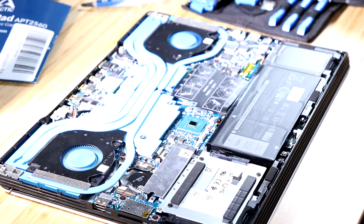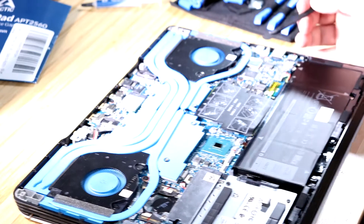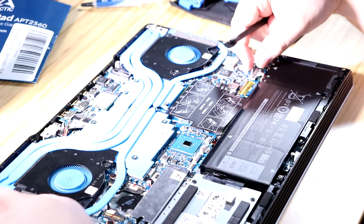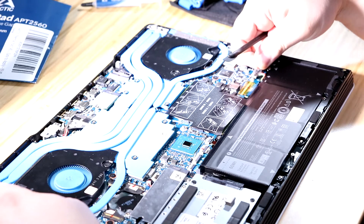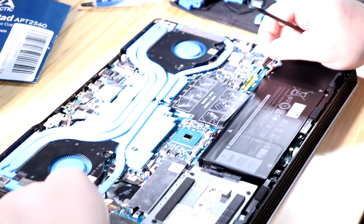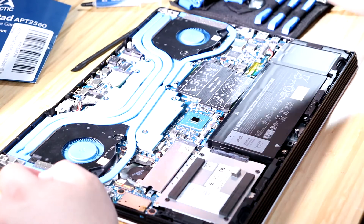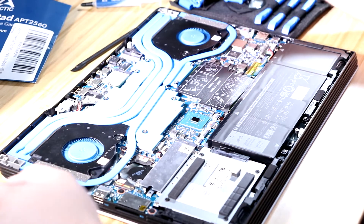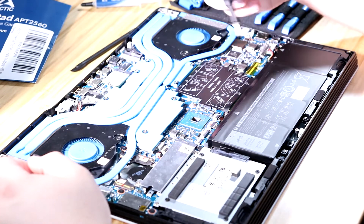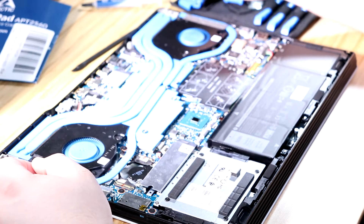With the back off, the first thing we need to do is unplug the battery. We're going to pull this off here for our power — it's right here, it says battery, it's over here on this side. Make sure y'all can see it. Now that the power's off — I've let this discharge for a couple of days — now that the battery is unplugged, we can go ahead and start removing our heat sink assembly.